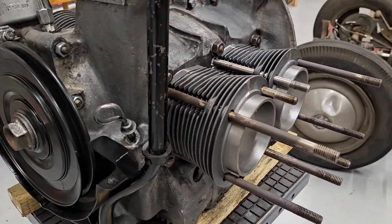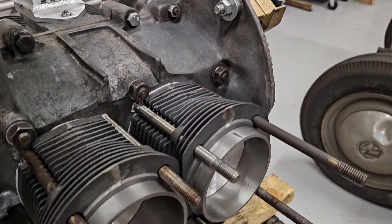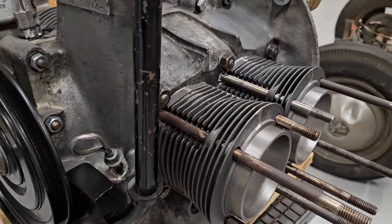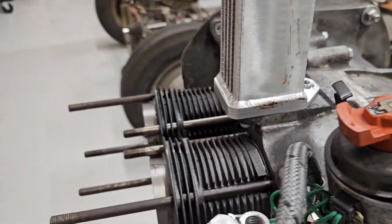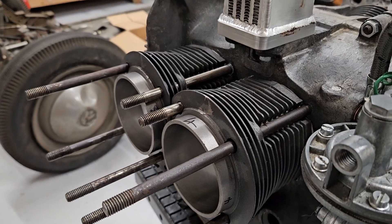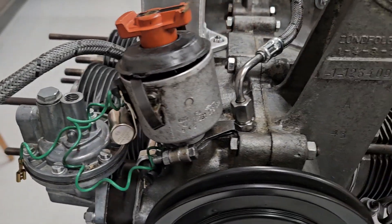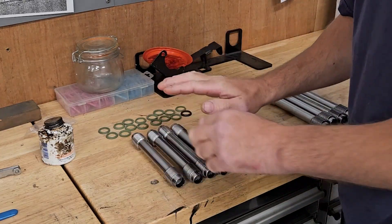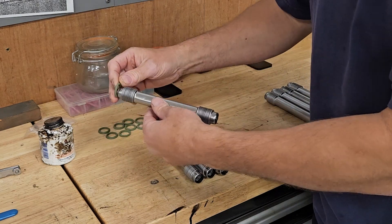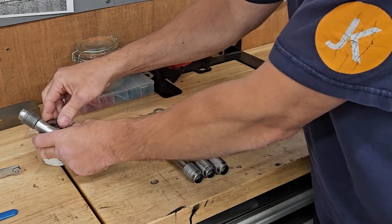The barrels are fitted to the engine with our pistons. I made sure we locked the flywheel in place so we haven't got any movement whatsoever, and I left the heads on overnight for the sealer to go off on the base of the barrels, as these have got spacers to get the compression ratio correct. The heads have had the new valves inserted and all the valves lapped in — we're ready to assemble the heads to the engine. We've got our four push rod tubes and we're going to pop the seals on, with a seal going on either end.